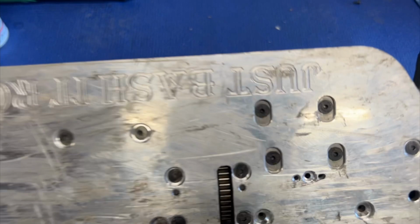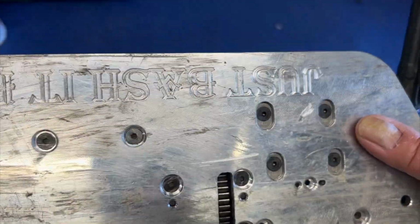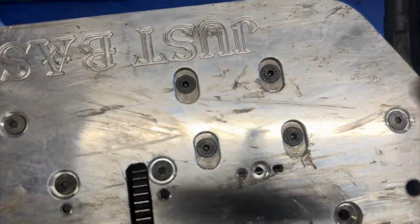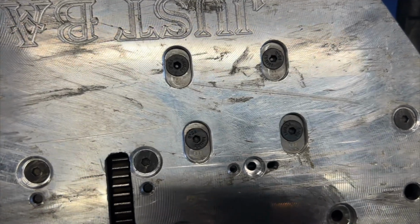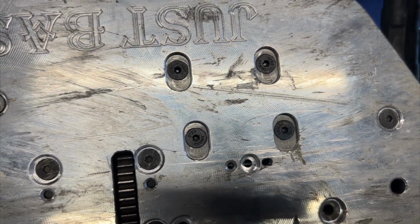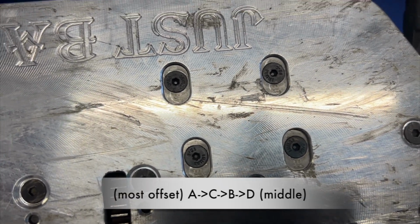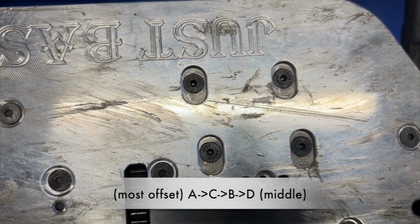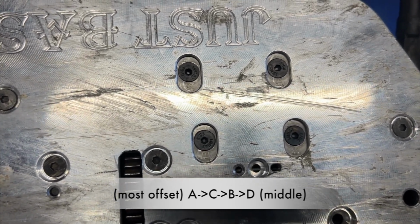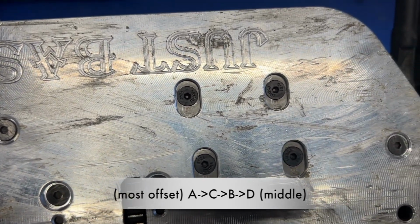So what we've got here is actually, can you see what's going on there? Those are inserts for the motor mount into the chassis. Hot Racing has just released these, I think a couple weeks ago. I bought a set of these and they come in 4 different sizes. I threw on the B size, so they make A, B, C, and D. B will allow you to gear up basically 1 tooth. Stock gearing is 13 tooth on the pinion. This allows you to run 14 tooth.